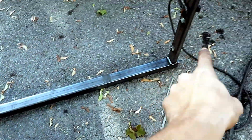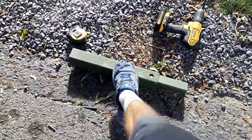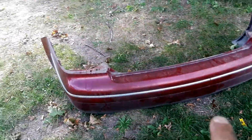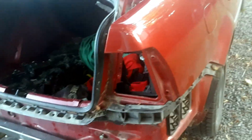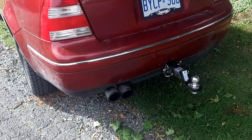I've got the bars in there and tacked the two-by-two main frame bar across them, took it off, welded up the joints real good, and now I'm going to bolt that back in and line up the actual hitch receiver part - already got the hole drilled in that too. I welded the piece of two-by-two on like we talked about, welded the receiver on all the way around, and gusseted it on both sides - I can literally jump on this thing and it doesn't move. Now I'm going to slap some paint on it, put the bumper back on, and get the lights back in.